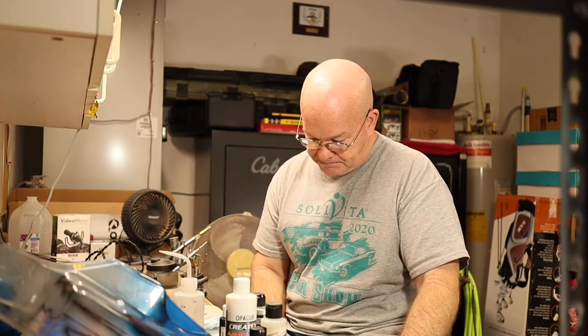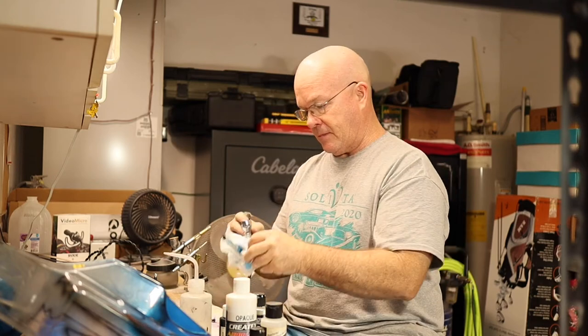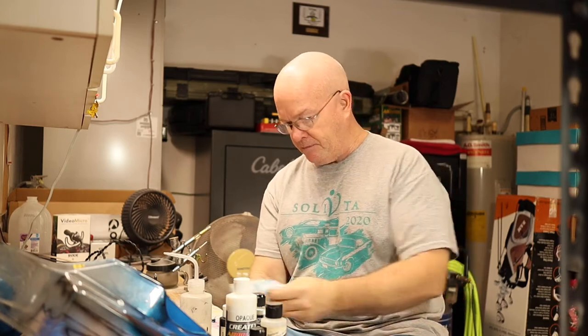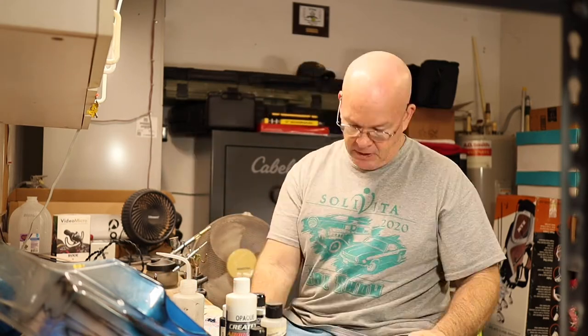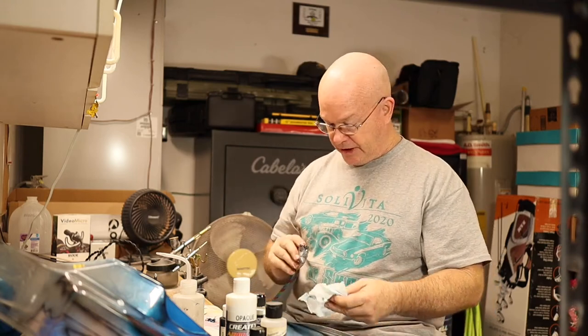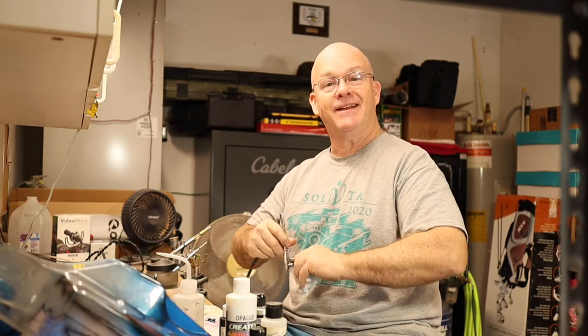I only put a drop of paint, literally one drop of paint in there. Now I'm going to go to the silver. Backbrush the gun a little bit. First cup I dump. Then I use my brush to clean out some of the paint from here. I have a garbage can under the workbench. I line it with cardboard and I just spray all my old paints and empty the water base reducers and cleaners in there. I'm not dumping it on the floor.